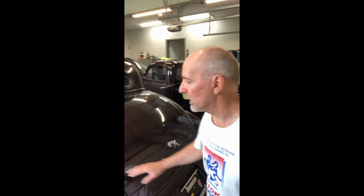It was kind of quick and not that interesting, but I just wanted to show you the method that I use when I'm polishing. We'll put the buffing compound on next, and that's a little bit less aggressive, and it should shine everything, some of the parts that are just a little bit dull. I could get it with this cutting compound, but the polishing compound should bring that out.